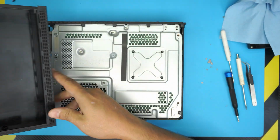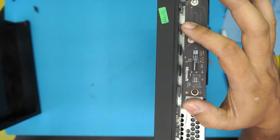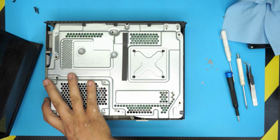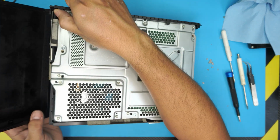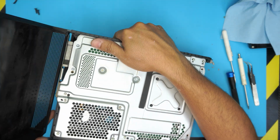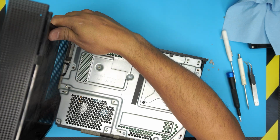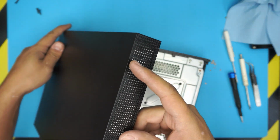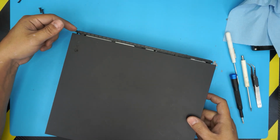Alright, and again with the top cover, the tricky part is where the Wi-Fi board is, so you don't want to slide it back in. What you want to do is place it in this position, place this side down underneath in there, so it's just gonna draw, put it there and then bring it over this side. So you want to put it down with an offset position.